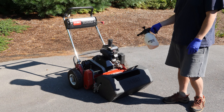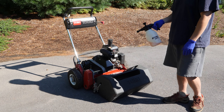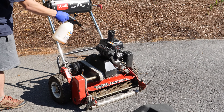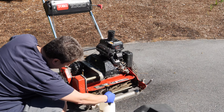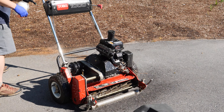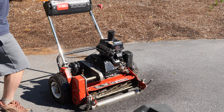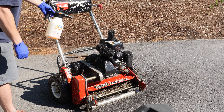Now that I've got it pumped up, I'm just going to spray the machine all over. I really don't cover anything. The only part I've learned over the years to avoid is I don't spray a lot of this on the starting rope or the part that you pull — that can sometimes make it bind up a little bit. But as far as everything else, I just spray all over. I'm taking the grass catcher off here because there's no reason to spray it while it's on the machine, plus I want to be able to get into the blade assembly. I'm coating the machine liberally. This cleaner is pretty expensive per gallon but I only use a small amount per machine. All motorcycle cleaners seem to work about the same way — they're usually touchless so you can just spray them off and hose them down without a pressure washer, which I generally avoid because you can push water into bearings.